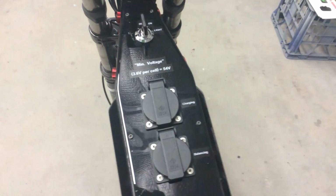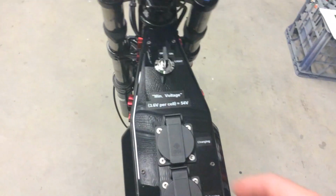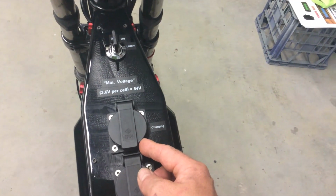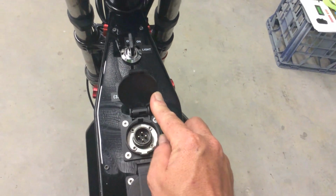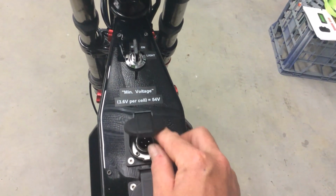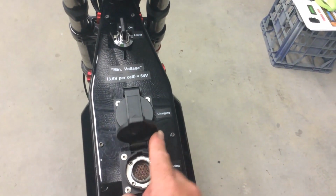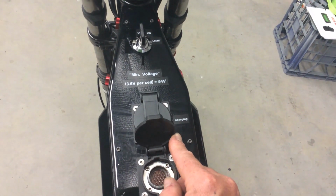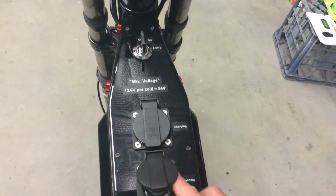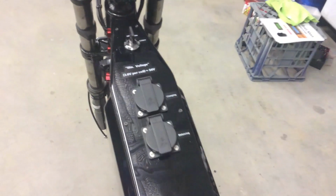So going back to here, it's obviously two separate batteries, an 8S and a 7S 10P, and this charging port is 4 pins, so it does battery 1 8S and battery 2 7S. And while that's charging, you're balancing it. So that's an 8S balancing and a 7S, which are obviously isolated once you turn it off. It isolates the batteries separately.